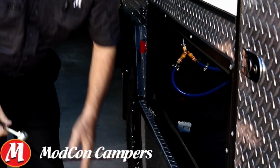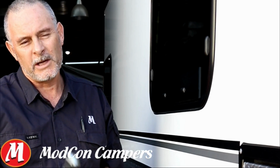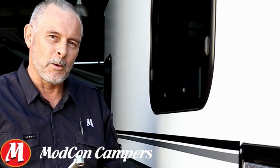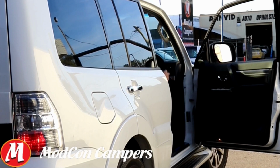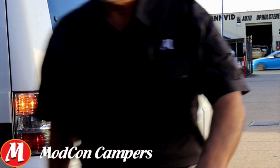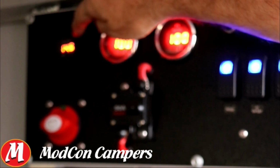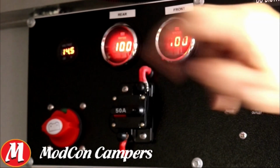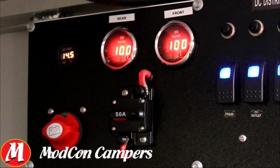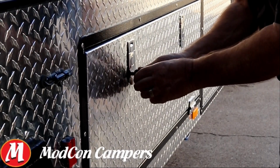This has got all my voltmeters and all my switches in it. So what I want to do here is leave this open, turn my vehicle on, because every time I plug something into the Anderson plug onto the trailer, I always like to double check what's going on with my voltmeter. I've come back in here to have a look at my voltmeter. It's sitting nicely in the 14s, which means it's charging, doing everything it should. My circuit breaker hasn't popped, so that's good. That's what I wanted to check out. Everything else is great. I can actually turn most of these switches off and just keep the one for the fridge running. And that's set. Now I can lock up this cabinet as well.